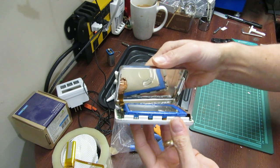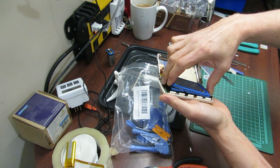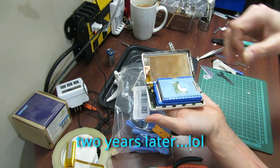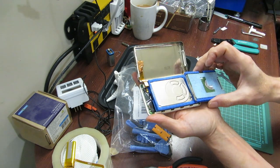There we go. Possibly for the first time since 2003, here is the inside of the iPod. Look at the size of that hard drive. Here is a 10 gigabyte hard drive from 2003. Here is, three years later — 2005 — the 30 gig hard drive. Look at the difference. They really shrank them down. And the interface is really very different — a much wider cable for that.